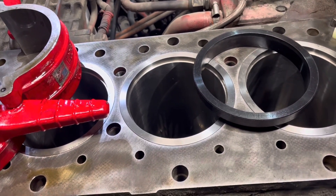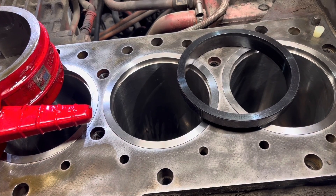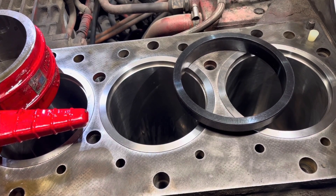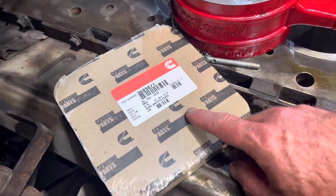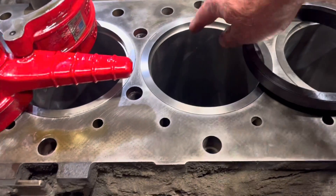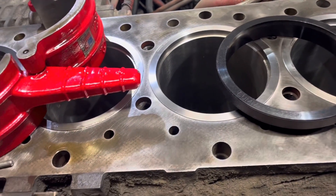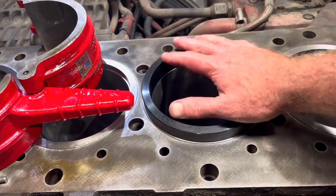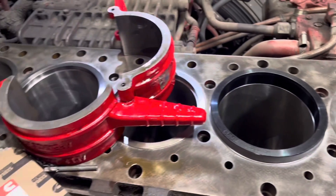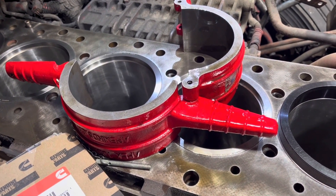Before we install this piston, I wanted to show you some special tools you have to have to install a piston correctly in this ISX-15. Cummins has updated their liners — they use what they call an anti-carbon ring, or anti-polishing ring, in this box right here. It's inserted into the liner after the piston is installed. In order to install the piston without damaging this lip, there's a Cummins special tool — part number 529-9339. You have to have this tool to install the piston into the cylinder. So now we're ready to put our ring squeezer — that's an Apex Tool Company, I believe a 5½ inch bore — around our piston rings and install this piston.